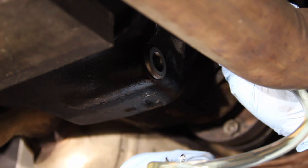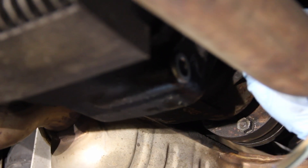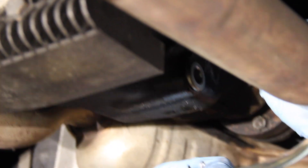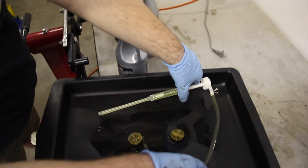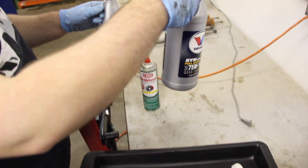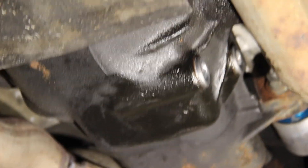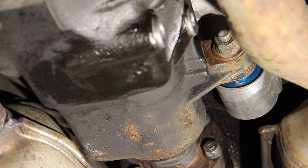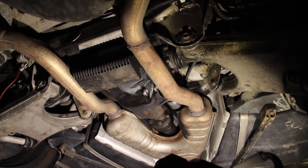The drain bolt and fill bolts are to be torqued to 45 Newton meters or 33 foot-pounds. It'll be difficult to torque the drain bolt precisely since we can't fit a torque wrench in there — 'guten tight' will do, as it's not under pressure; you just need to crush the copper washer. We ended up using about 1.4 quarts total. New plugs, new fluid, everything's tight and torqued to spec. Lower the car and you're all set — that is the differential fluid change on the E39 M5. Thanks for watching.